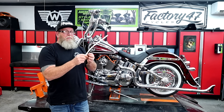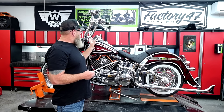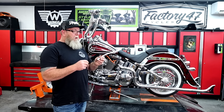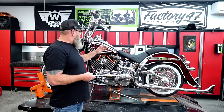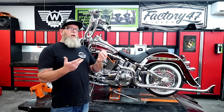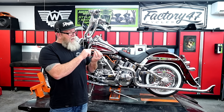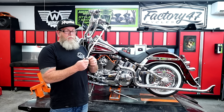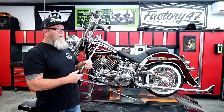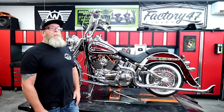So what happened is I was pulling it up and it was so brittle that this piece down here broke. Now this is an aftermarket one that I purchased. We put it on the bike, poured a little fuel in to get it fired up, got everything primed, and as soon as I hit about the third or fourth prime, this check valve started pouring fuel all down the side of the engine. So I took a trip up to Harley-Davidson yesterday and picked up a Harley one — these are the same ones that go in the touring models as well. The aftermarket one does have a rubber O-ring inside, but it was directly leaking right out of the check valve itself. So that one is garbage. Purchased the Harley-Davidson one for around 60 bucks, put it in, leak stopped, everything was fine.